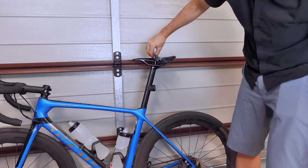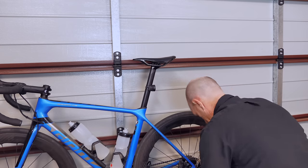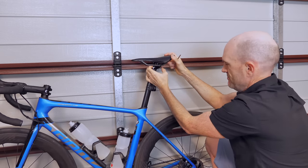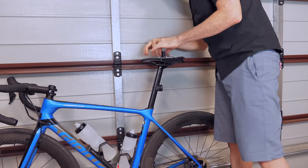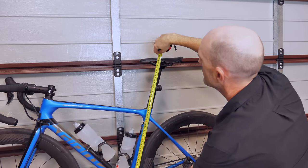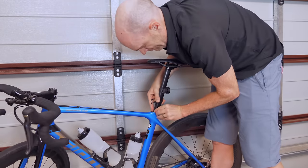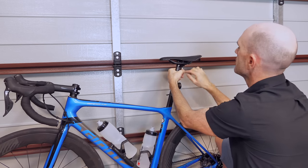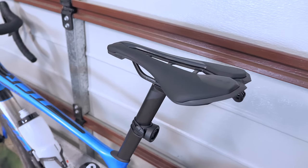Without the supplied 80mm tool I made my own and measured out where the 80mm cross-section was on the saddle and made note of that. Also taking the saddle height — even though I could have used the garage door as reference. With that recorded, the saddle comes off. Always a tricky task to remove a saddle and install a new one without totally dismantling the saddle mount bracket. Very convenient to have the 80mm section marked on the saddle already. That's all lined up. Final saddle height check and it's a little lower — about 5mm different to the Cadex Boost. Out with more tools and torque wrenches to get that adjusted. The finished installation: the Pro Stealth Team installed on the Giant TCR.